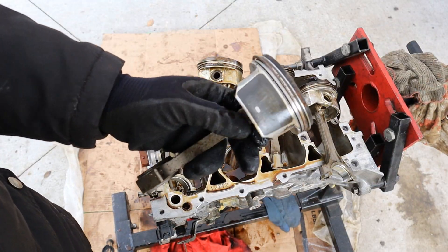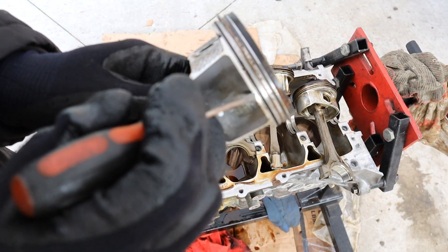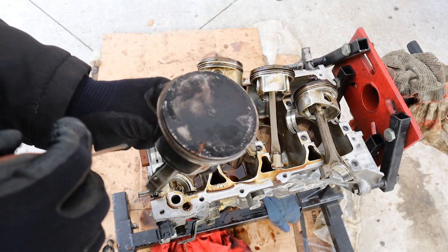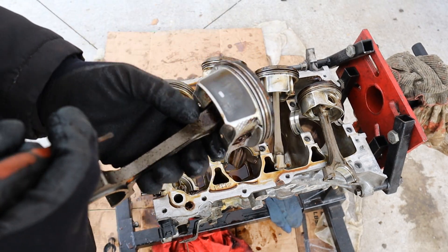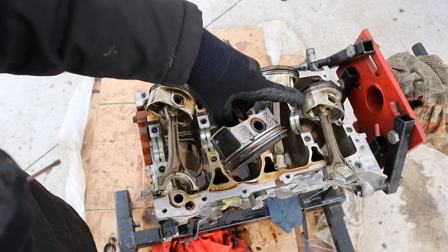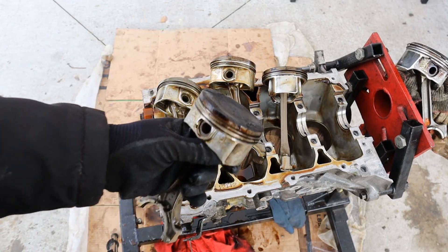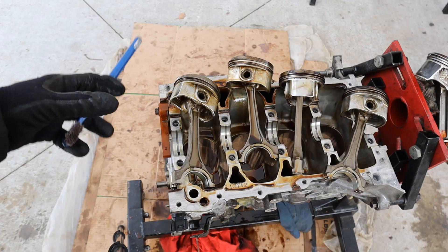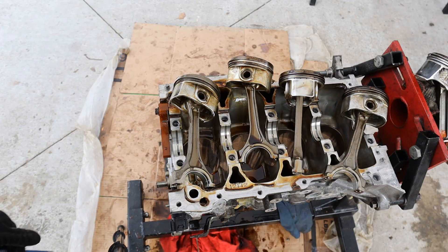On the other hand, here is a normal modern piston. You can see the oil control ring actually has three pieces — a top, a bottom, and that corrugated section which has lots of space for oil to flow in. Therefore the oil will flow through and flow back down on its downstroke, and not end up in the top of the combustion chamber where it burns out through the exhaust. Obviously with any engine, lack of maintenance is going to cause carbon to build up and clog these things — and that'll be even worse with an oil control ring design like those low tension rings. Oil burning is bad for the environment, it's expensive, and it eats out your catalytic converters — which on a Prius is really expensive to replace. Moreover, oil burning is really bad because people don't know how to check their oil, then their engine blows up because it runs out and ends up on my YouTube channel for a teardown video.